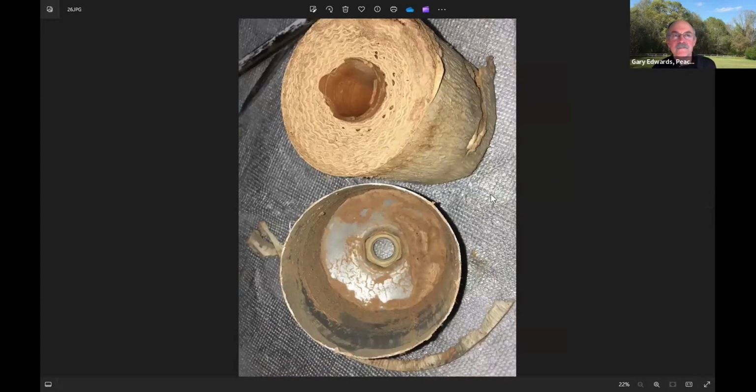And then my little embarrassing time when I had the car quit. Two times during this maintenance, the car actually quit. One of them was, this is the fuel filter that I took off when I was troubleshooting that quitting. It turned out the car had a fuel gauge that stuck at 1/3 of the tank, and I had just run out of fuel. I am embarrassed to tell you how long I spent troubleshooting, figuring that out. But that was kind of fun.